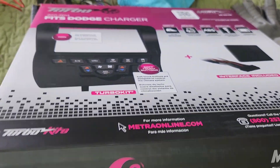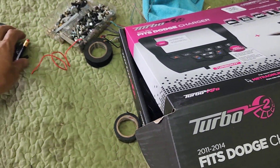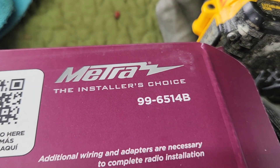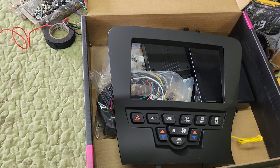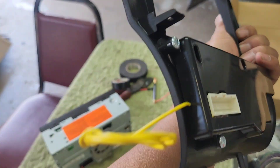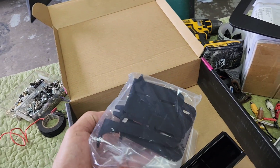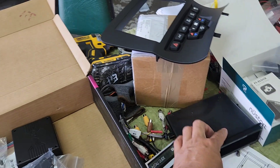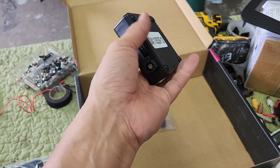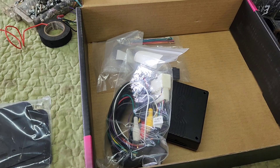Now this is the part that we bought. This is a fit for 2011 to 2014. So this is what they came with — that part right there. You need to plug that for the controller. The yellow piece is the antenna. We're doing a double DIN. You don't need this for a single DIN. You need this wire, and this is the box to control everything else. This little piece will go there. I'm going to start doing it and show you step by step.